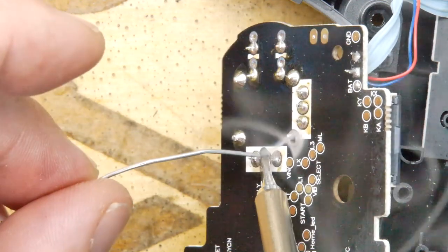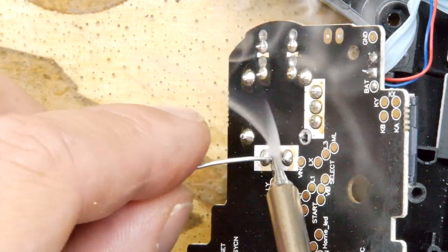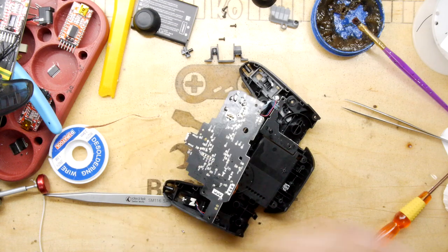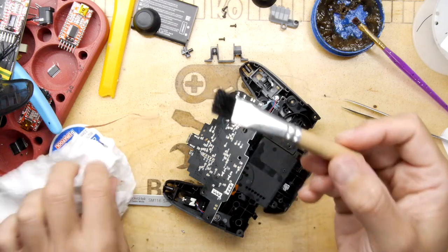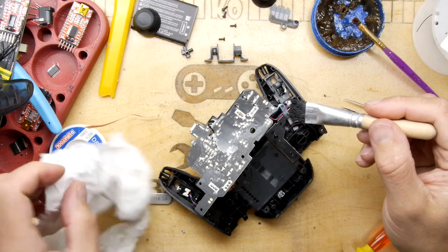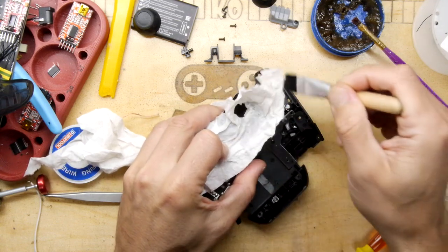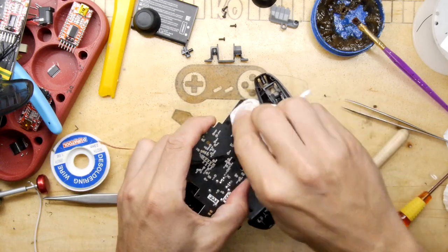If you're very hygienic with your soldering, it's probably a good time just to give it a quick clean down. Let's check out the other thumb stick and give it a little clean while we're here because we've got the old IPA. Rubbing the IPA there - get that flux off. You might say, Andrew, you didn't add any additional flux, but remember your flux is in the solder too - it's all a fluxed solder.